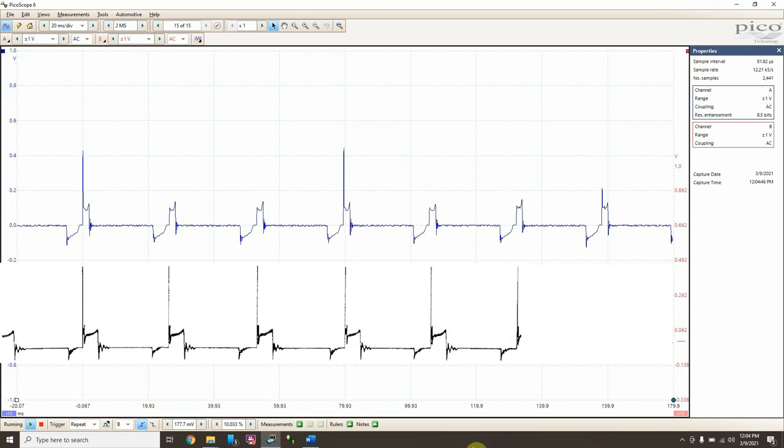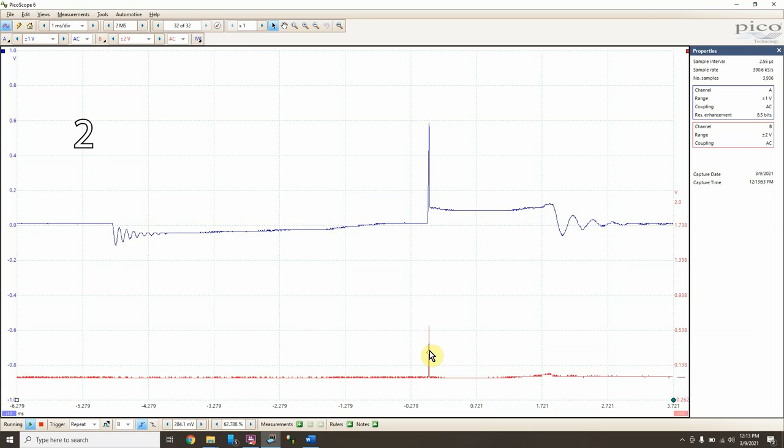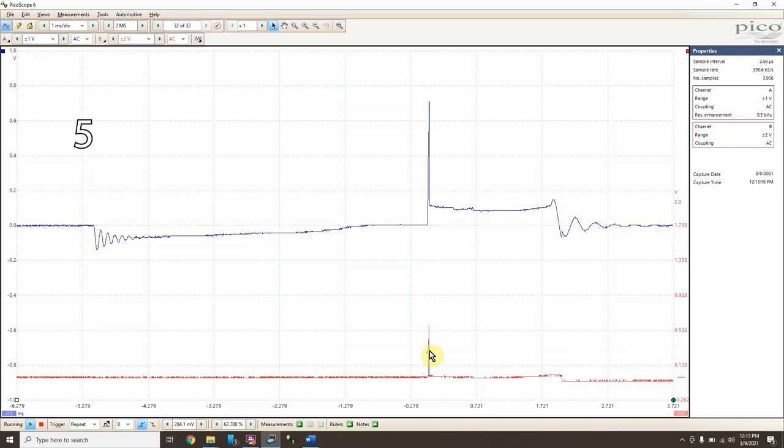These images are what I pulled when I got back from the shop. They really don't look any different than the ones I captured before we went to the shop, which is kind of interesting. Let me overlay an image from the actual Porsche shop manual — that might give us a little reference. Our cylinders are in the firing order: one, six, two, four, three, five. It does look a little different than what's in the shop manual, but the most important thing is that it's very consistent across the cylinders. Looking at each cylinder independently — all I did was move my trigger clamp through each one of the spark plug leads — they're all remarkably similar and very difficult to tell apart.